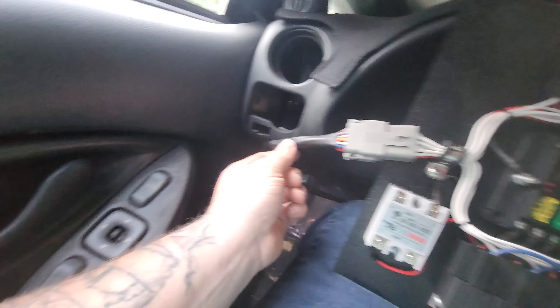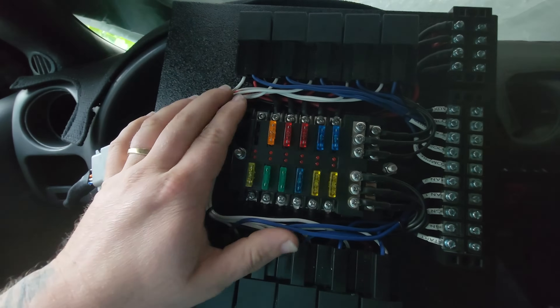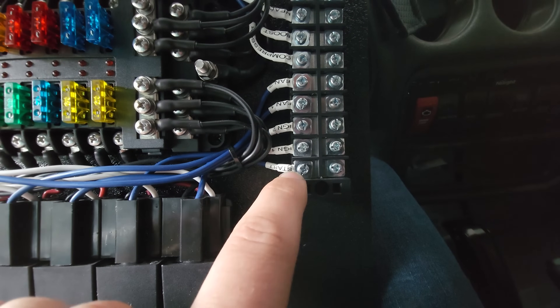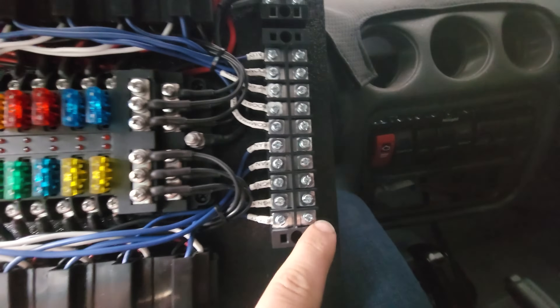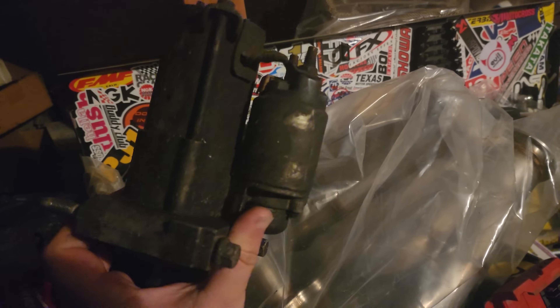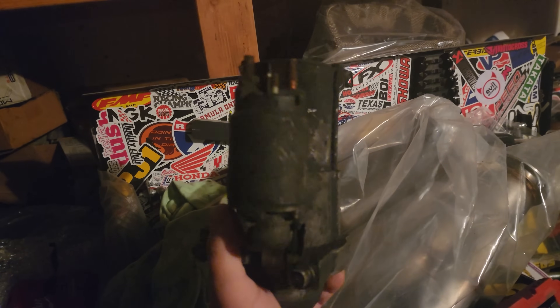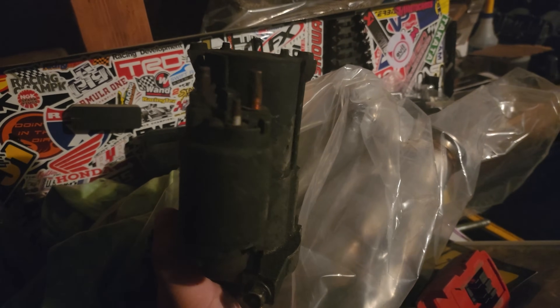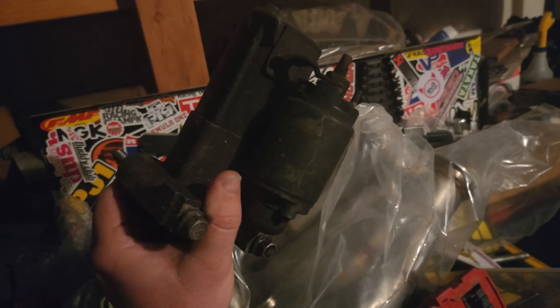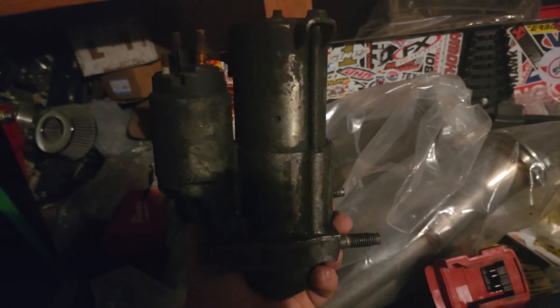This momentary switch is going to go to our starter. The switch has a wire that runs through into one of these relays. The relay will have an output wire that goes to one of the outputs — starter. You take that wire and run it to a starter solenoid. On newer vehicles there's usually a starter solenoid on the starter itself just like this. There's a trigger wire, and basically from the relay the trigger wire is going to go to it — and that's where it will tell it to start the starter. Simple as that.